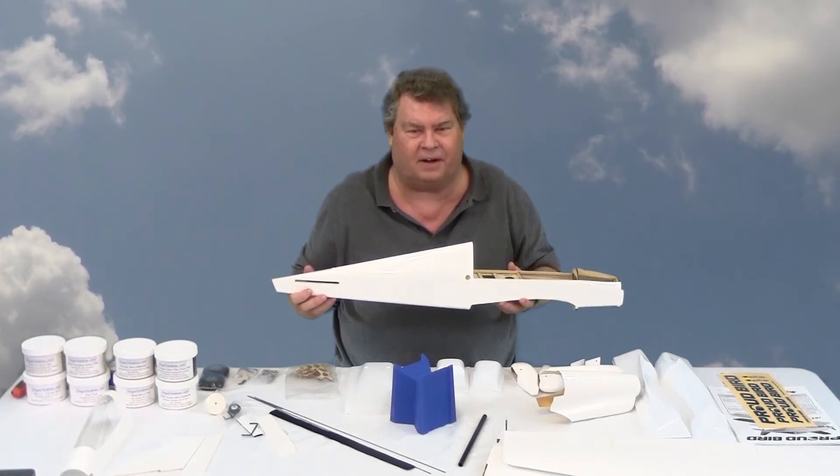If you're going to race, consider the ElectriFly EF1 motor. For an electronic speed control I recommend the Castle Creations Phoenix Edge 75 Light. The non-light version has a heat sink on it, is fairly heavy — at least an ounce more — and you don't want to add extra weight up front on this airplane. The cool thing about the Castle Creations series is that they have a data logging feature, so you can download information from a flight or multiple flights to your computer and see the battery current draw and RPMs. When you're racing you'll see spikes in the turns because it's putting more load on the motor, and it makes it easy to see what your lap times were.